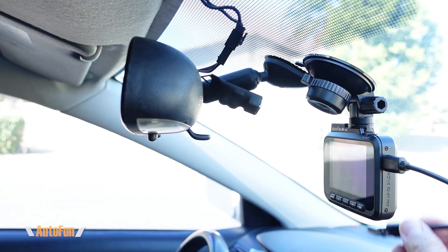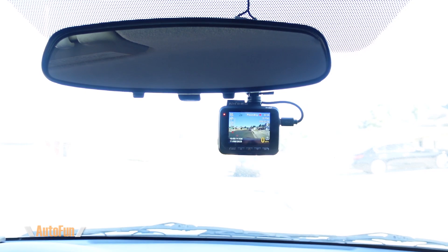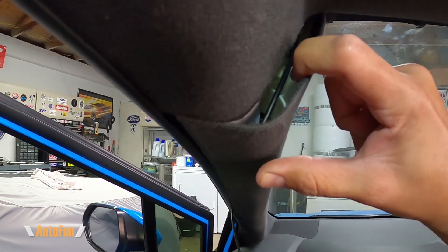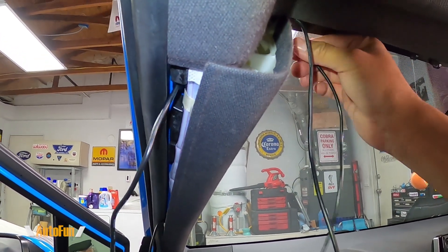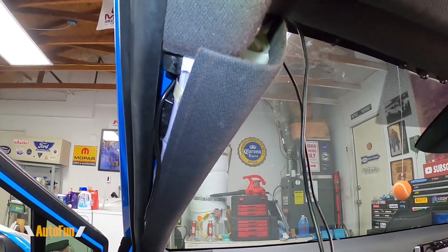The mirror adapter comes with a shorty cable which I can then use to connect it to my dash cam. One of the big advantages of this power setup is that it eliminates the issue encountered when running cable along the trim of the car, and that is potentially running into a live airbag. Installing a cable over a live airbag does take a certain level of bravery, and leaving a cable installed over the airbag can potentially cause an issue with the deployment in case I were to be involved in a car crash.